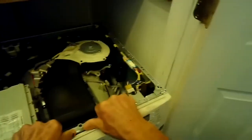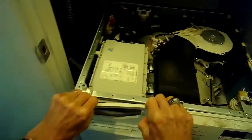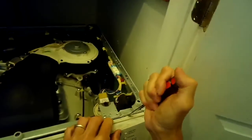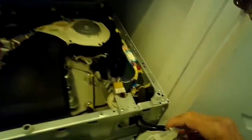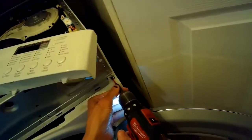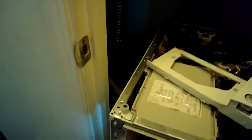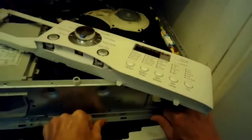We're going to pry off the front panel — just pull it toward you — and there are a couple of catches you want to push down with the standard head screwdriver on the right side: one kind of in the middle and one on the right. Then you can get the control panel off and lift it out of the way, which will allow you to get to a couple of Phillips head screws at the top of the front panel. Zip those out and then lift up a little on the front panel, pull it back toward you, and it'll hinge back to about 45 degrees so you can lift it off the two clips holding it at the bottom.